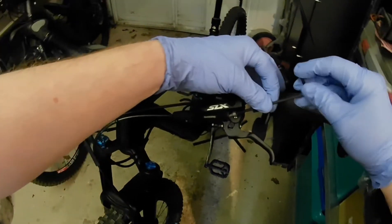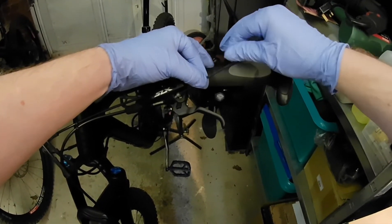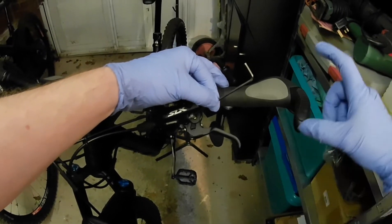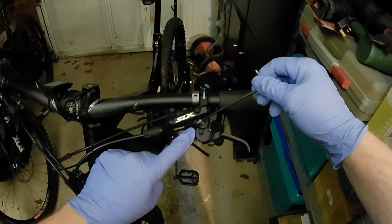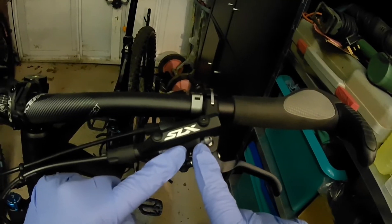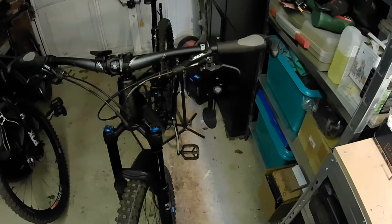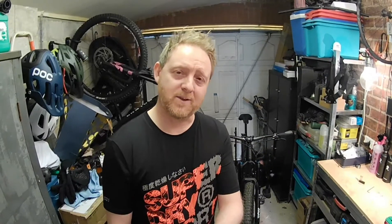You eventually get to a point where — hopefully as I'm turning this you'll see the lever start to adjust. You can see the lever adjusting now, and what that's doing is eliminating the free throw, bringing the biting point closer so you don't have to pull the lever as far to get the brake to bite. You will come up to a natural stop — don't try to over-tighten this because you can damage the mechanism inside. There's around about a four to five millimeter gap between the cap screw and the brake with just the thread showing — that's perfect, that's exactly how it wants to be. Hack done for about ten pounds.